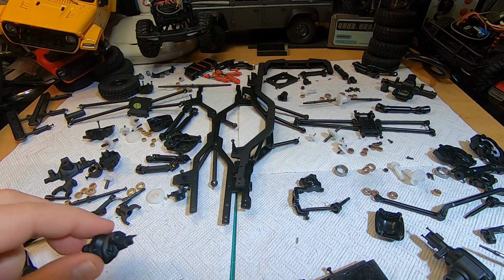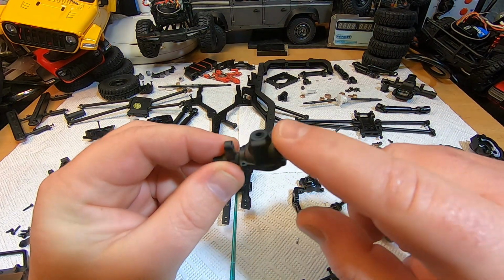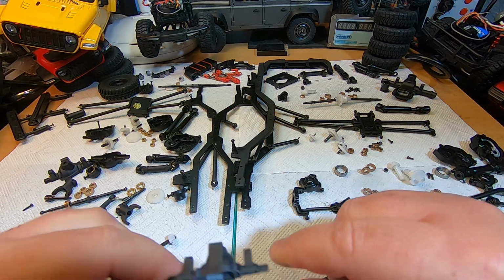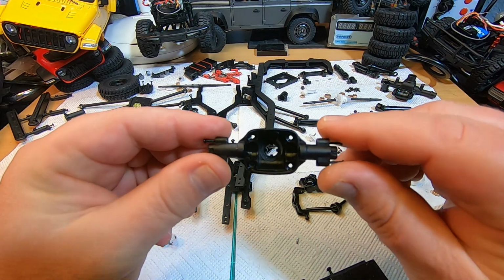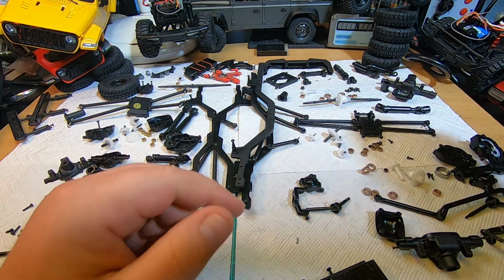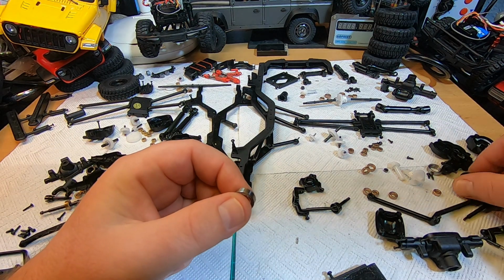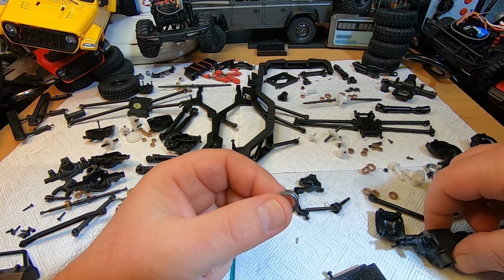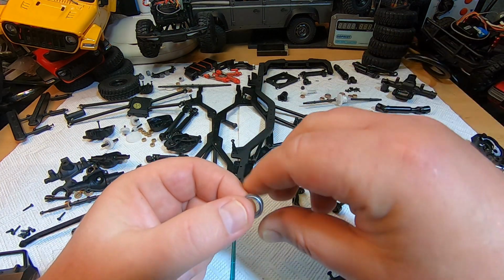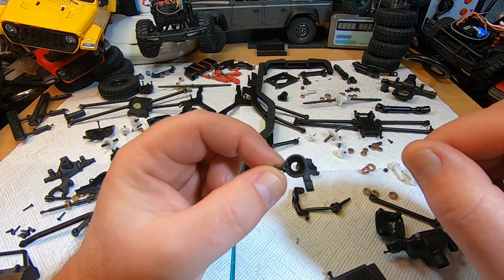In the front axle it's absolutely the same with the RocHobby Katana, using only one bushing for supporting the small gear, and the Patrion and the Arizona, the EazyRC models, use two bushings. What's really nice, the EazyRC models do come already with two ball bearings, those large ones, which go to the C-hubs of the front axle. Where is it? Here inside. So you do already get ball bearings, and the RocHobby Katana and the HobbyPlus models use bushings here too.